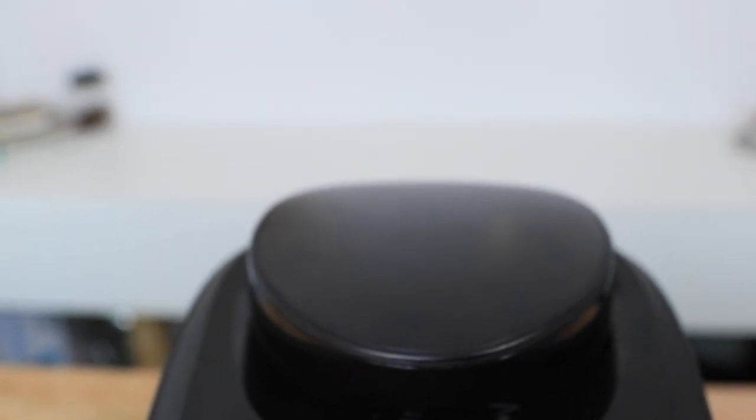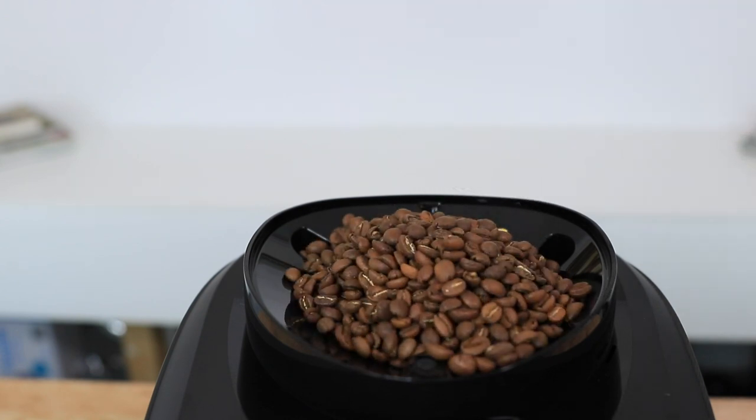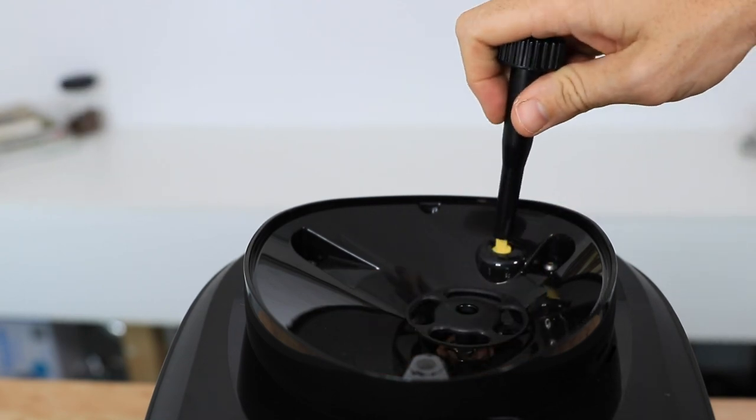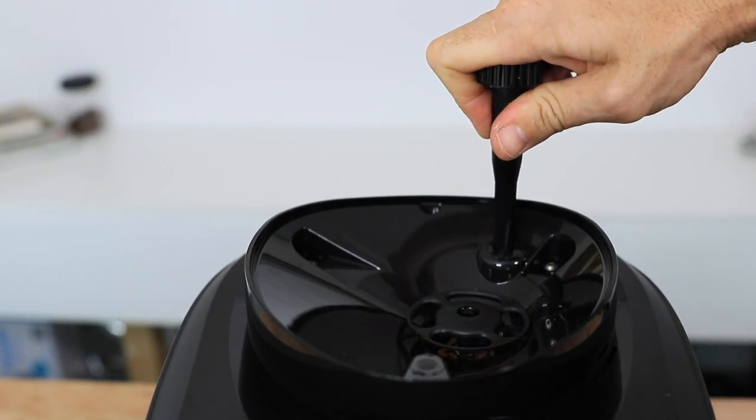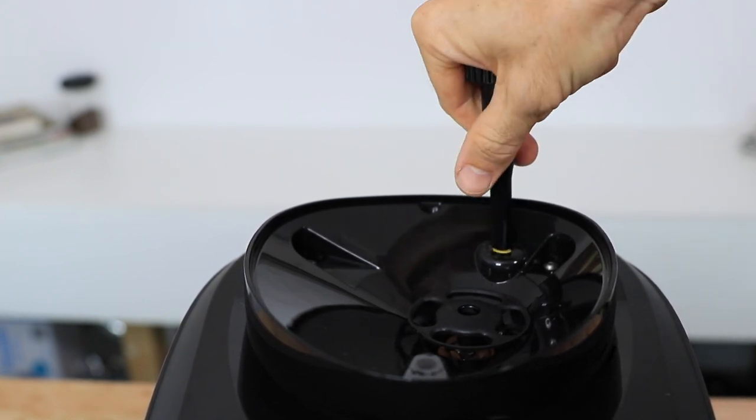From the top of the machine is where you will add your coffee beans. It holds around 180 grams and this feeds straight into an internal grinder. From here you can also adjust the grind settings in five incremental clicks from the adjustment switch just behind it. In my experience on a majority of these automatic machines the grinder is usually the weakest part — they often use ceramic burrs which are not known to be great for espresso brewing, and have a very limited grind setting range. I would suggest setting the grinder to its finest setting prior to adding beans into the hopper.